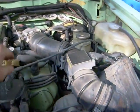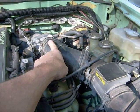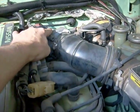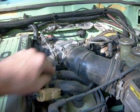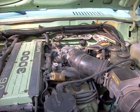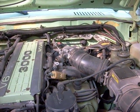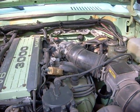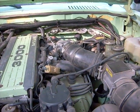The intake hose is off of an 87 Stanza wagon. It's got the 3-inch up front, and I believe it's 2 and a quarter in the back. The throttle body I took off a 95 Altima after doing a little research. Mill and Motorsports wanted an arm and a leg for an enlarged bore throttle body and butterfly. The intake is actually larger in the back — the throttle body is smaller than the intake — so this Altima throttle body is a little over 270 thousandths larger than stock, and it bolts right up.